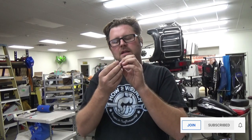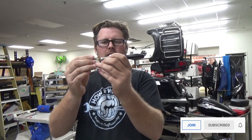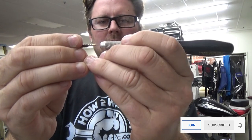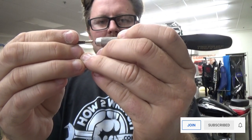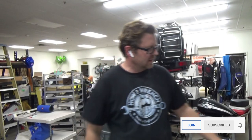Like I said, the argument here was that you were going to make it larger, but it's about feel. We're just trying to poke the varnish, not dig it through the jet, not twist it like a crazy drill. But just being transparent, I will sometimes get this in here and give a little twist, a little bit like that. But like I said, it's so much about feel. Done this a million times. I'm not drilling this jet or making it bigger.